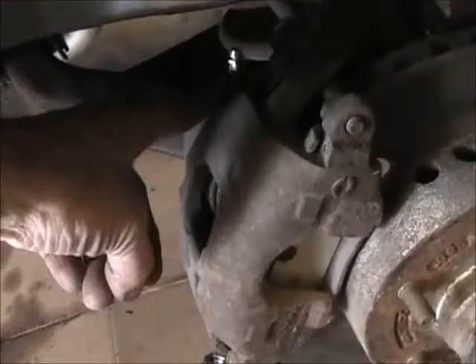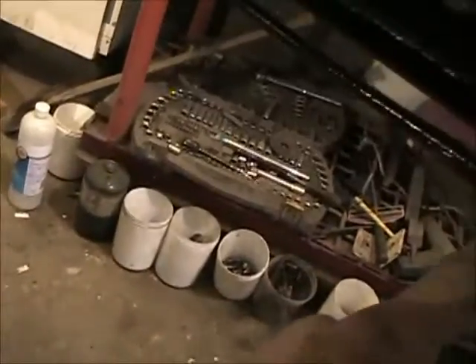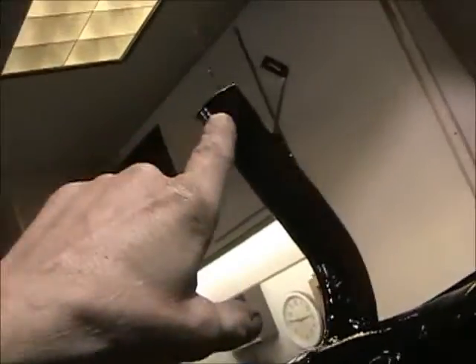When I got the two-door car, all it had was rubber line from one end to the other. I did get my new bleeders — I haven't bled them yet, I just switched them out, so I got to do that. Next weekend I hope to have fuel coming from the tank to here. My buddy was down and soldered this in for me — the new return line. The old one only went to there so I put a 90-degree fitting in it to go over here, so that's done. I re-welded it with the gas on, which I forgot to do initially, and then to top it off when I was painting I forgot to turn the compressor on.